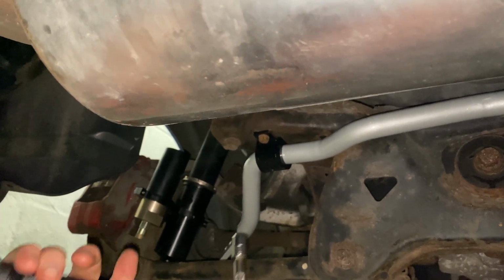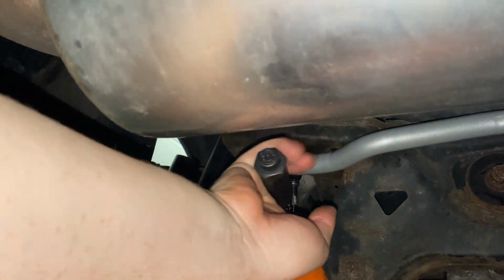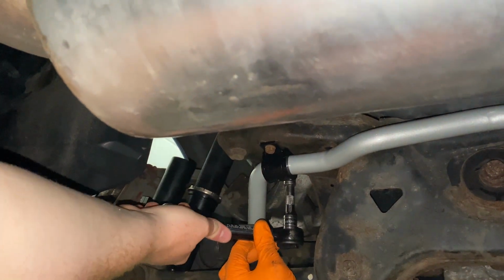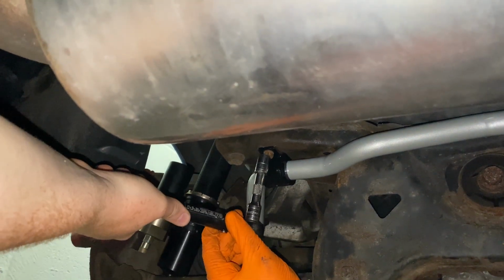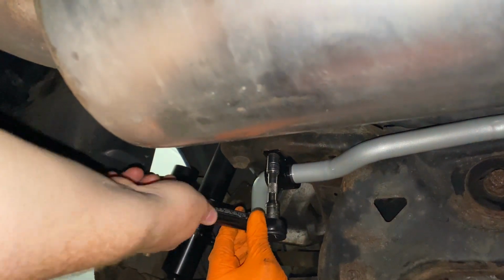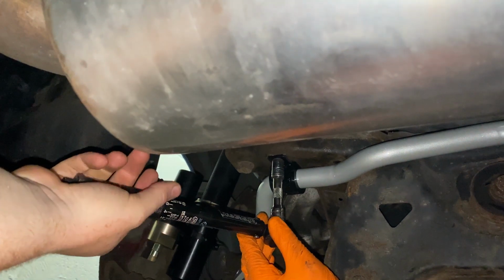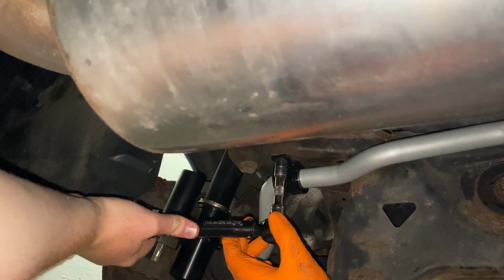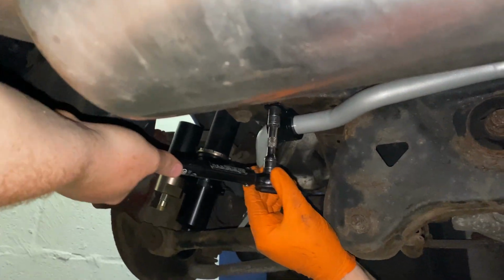Hopefully we can fit them after I've torqued it up, because it's already tight now. And that's the importance of torquing. I thought they were tight, because they are pretty tight, but obviously there's probably another 4 rotations on each of those bolts before they've become torqued.